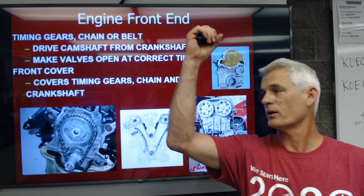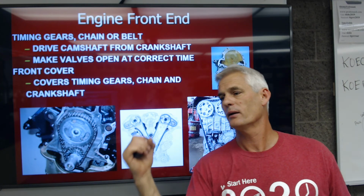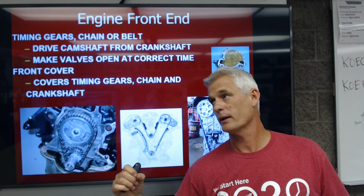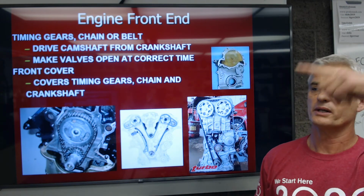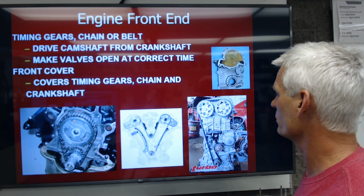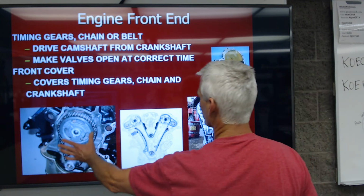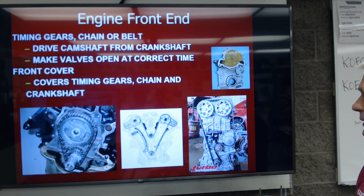That's because the crankshaft down here goes down, that's half a turn, that's intake, compression, and then power, and then exhaust. The camshaft opens the intake and exhaust valves, so that's one rotation of the cam. The crankshaft did two rotations, okay? So it's a 2-to-1 ratio. This is an older American V8 with a chain type connection, chain and gears.